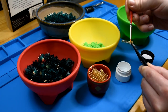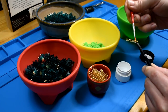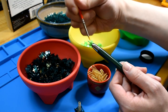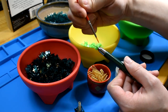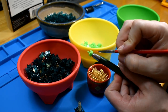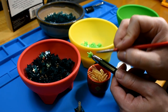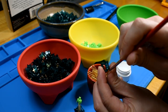Even more than most, these really come alive when you lube them, but maybe for different reasons than usual. I tested individual switches with Krytox 205 Grade 0 and 106, and decided to go with the oil. While the smoothness itself only saw slight improvement from its already admirable position, the sound improved significantly. Gone is the raspy, slinky sound, and gone is the rattle of the stem against the polycarbonate housings. In its place, a luscious, plucky sound.